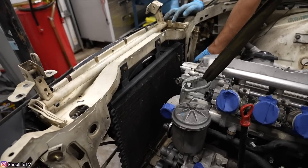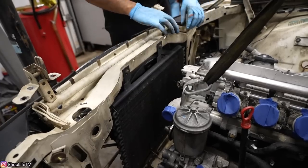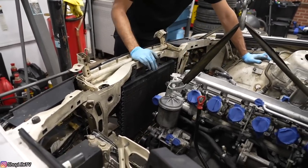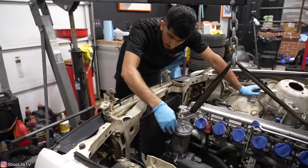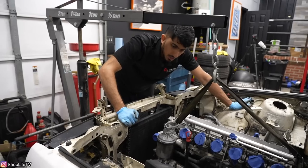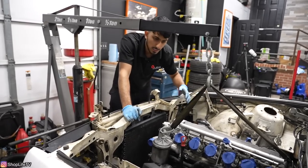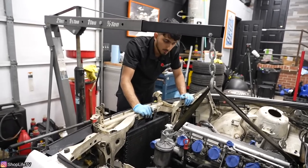It's going to be spot welded to the frame because it's not like the E46s and E36s where you can just remove this whole section — it's like the JDM cars where it's all one piece, spot welded. With the bare long block on the S54 we still have some accessories here and there are no issues. But obviously the subframe is not going to work — I'm looking at the oil pan and it's right in the middle. So we're going to have to make a custom subframe.